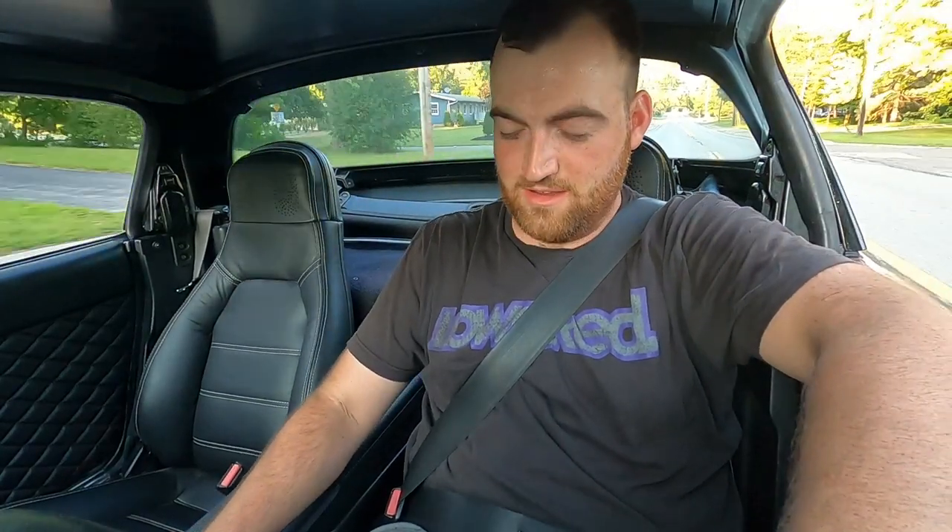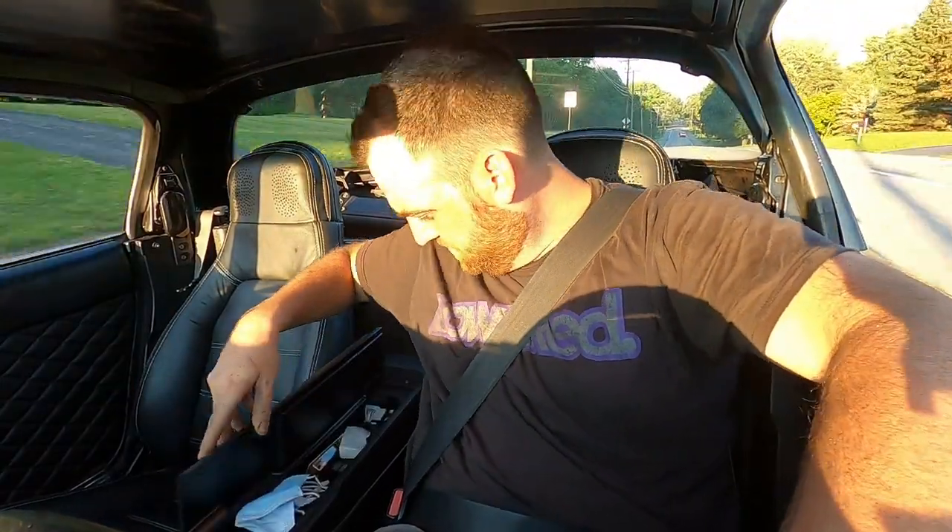Going out for the test run right now with the 3.63 just to see how it feels — and I forgot my sunglasses of course. I did not replace the speed sensor in my transmission, so I have a speedometer app via GPS on my phone just to see how far off I actually am when cruising, so I know what to target on the speedometer.